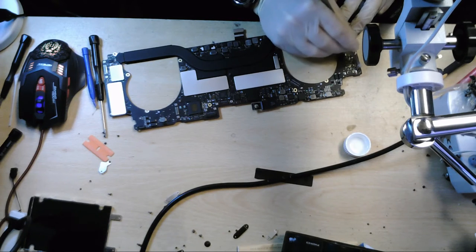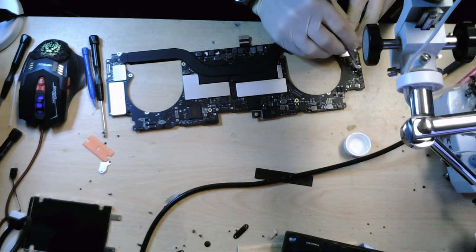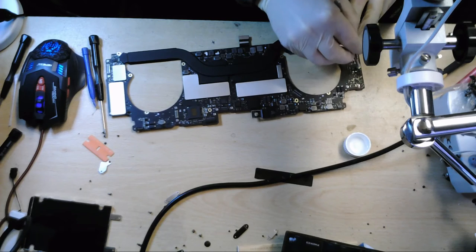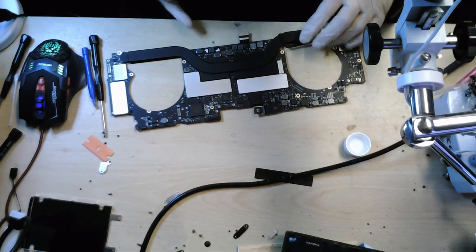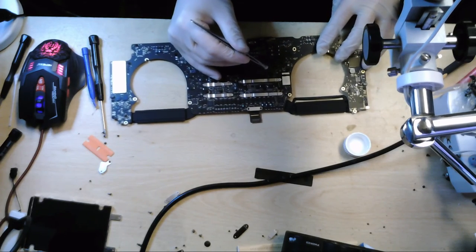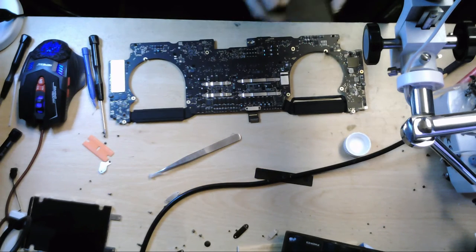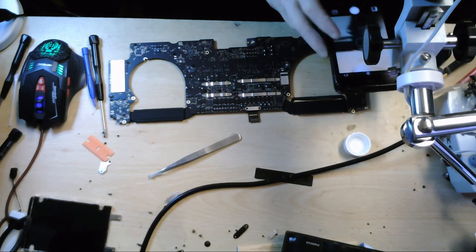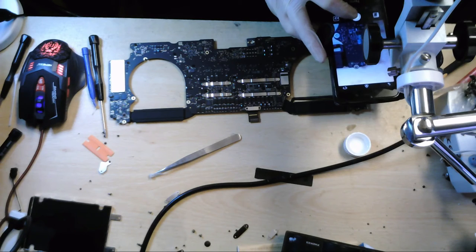What we'll probably also do is get a toothbrush onto this, just to help get any of the other parts where we can't quite reach, like in between that gap there. Right, let's go for the other side, where this liquid has also managed to get to. And again, let's take some photos just to make sure that if we do need to come back, we know where the damage was, we know which components potentially might have been damaged.